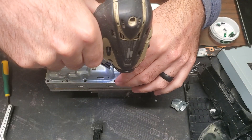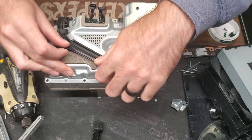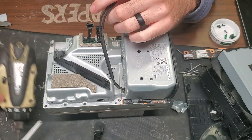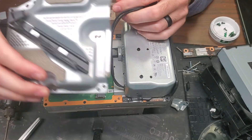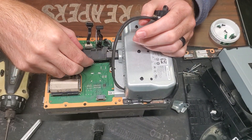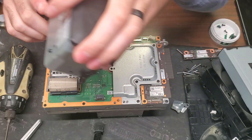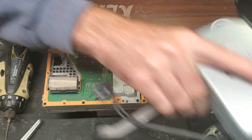There's a little cover here — underneath that cover we have another black screw, go ahead and take that one out. Then we can pop up this little cable holder here for the power supply and slide this out. Then we got to pull up on this tray here — there's another screw that I forgot, right here. We're just going to pull up and carefully slide it out. Now we have another cable holder right here, so go ahead and open that up. Then disconnect — this connector here has a little tab on it, lift that up. There's another tab right here — push in on that and pull up, move side to side very carefully on the power supply.